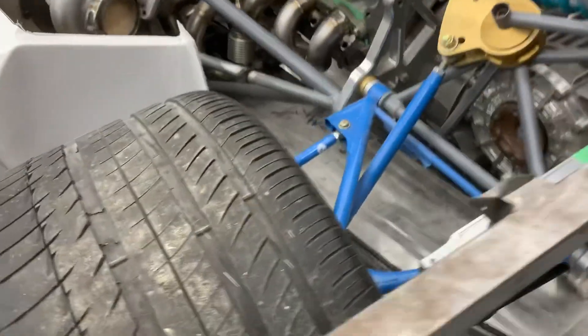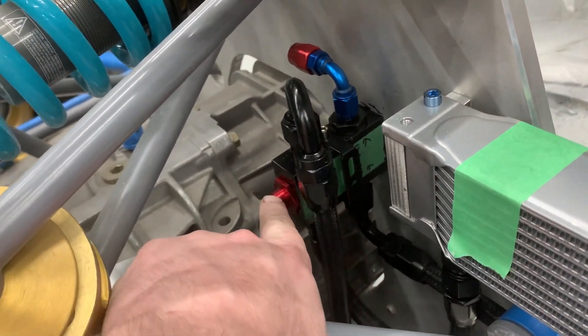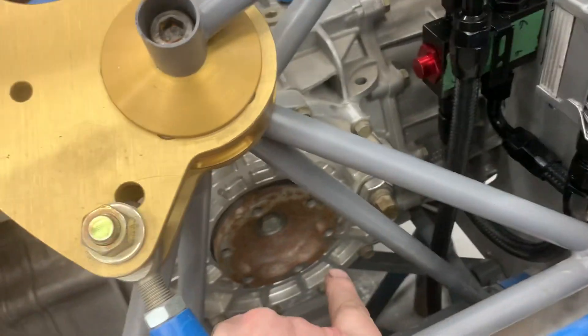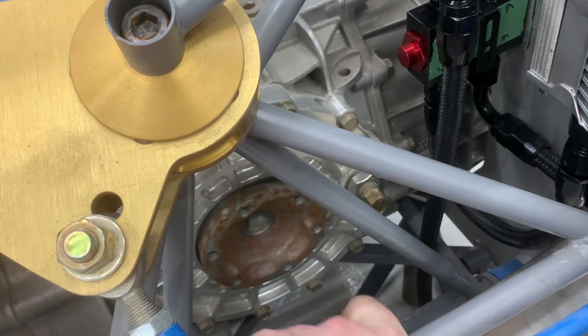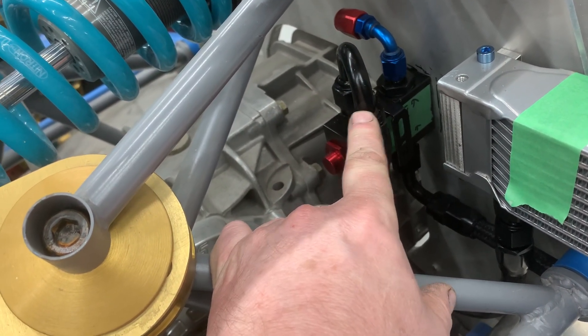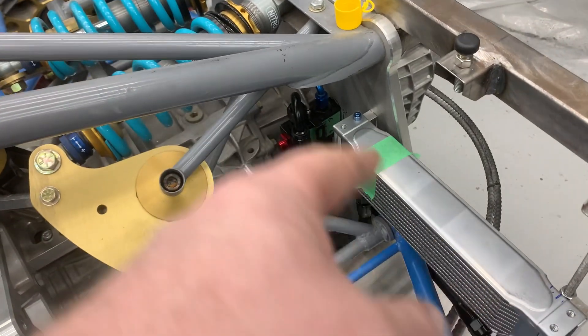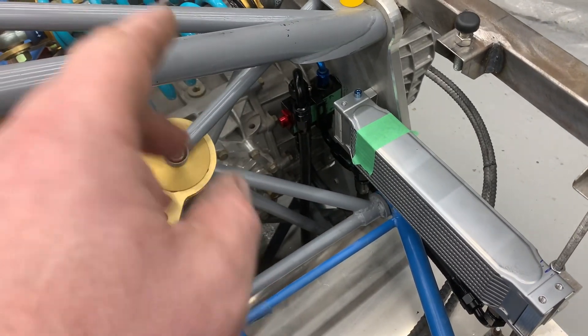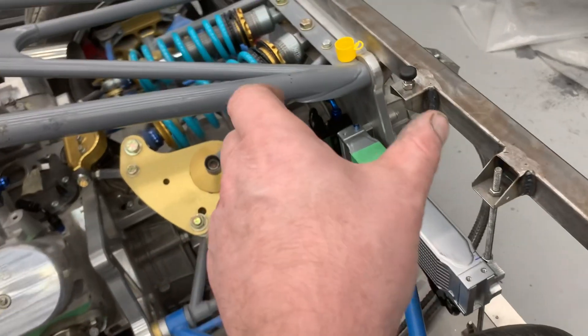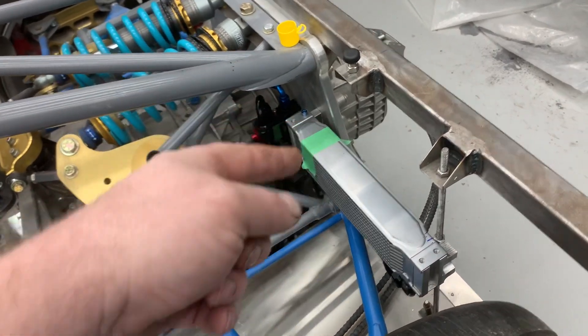Lots of fittings arrived. Oil coolers - we mounted that last time and I started figuring out the plumbing. This is the thermostat for the gearbox oil cooler; we'll have the pump and stuff underneath, waiting on one more fitting. I had to go to a plan C on the pump fitting location - I'll have to make a pump bracket. The stat is positioned now and I'm happy with it. When she's too cold the oil will short-circuit bypassing the oil cooler, then once the wax in the thermostat heats up it blocks the bypass and oil has to go through the oil cooler.